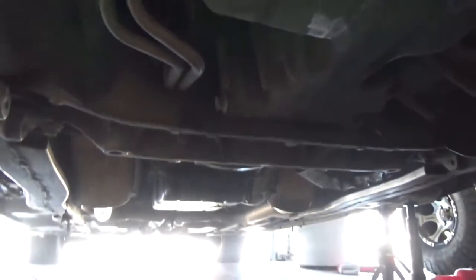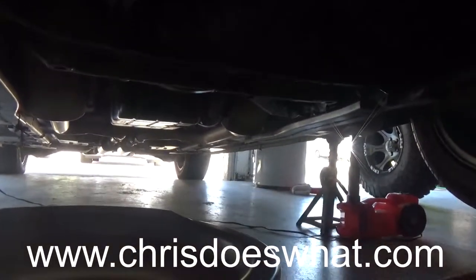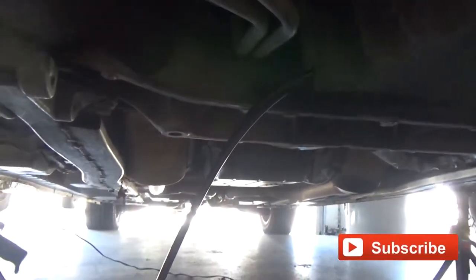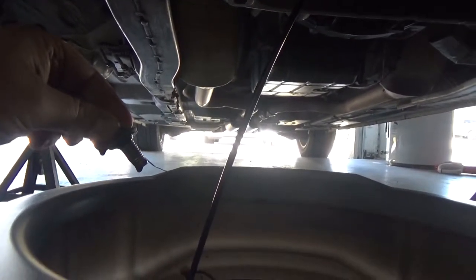So when you're placing your oil pan, move it out to the farthest edge from your oil plug, where it can still drip down, because this oil is going to originally come out with force. Then take a wrench or a socket wrench and loosen that plug. Finish taking it out and you'll see a nice flow of oil. You see it almost reached the far end of our pan. Make sure your pan is wide enough to accommodate that.